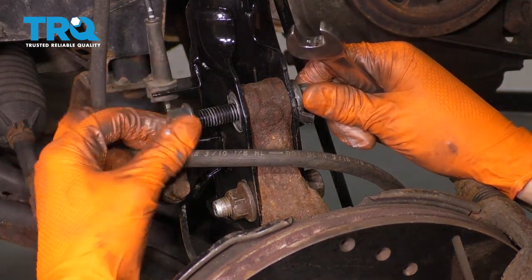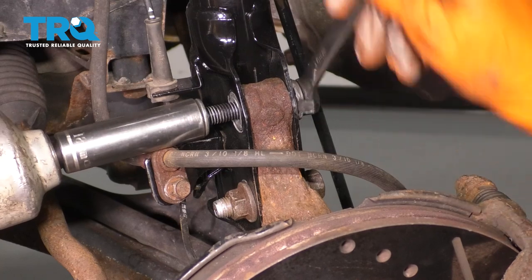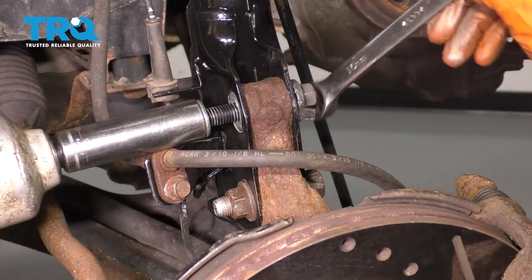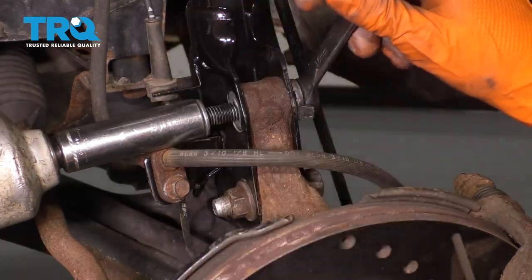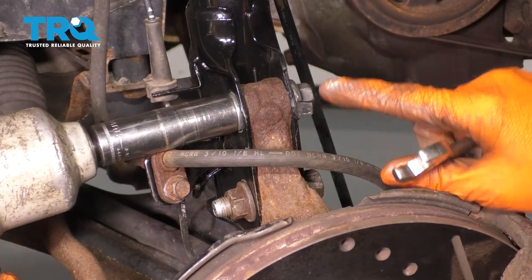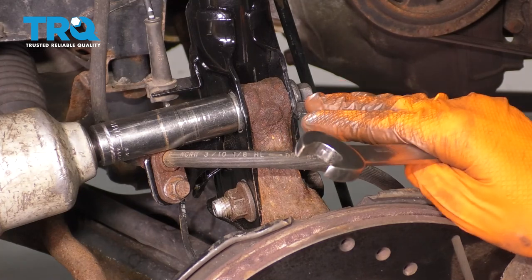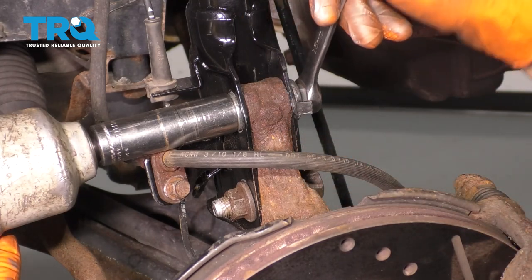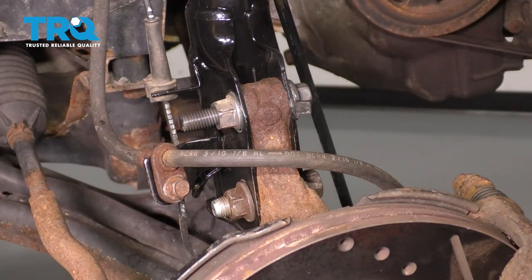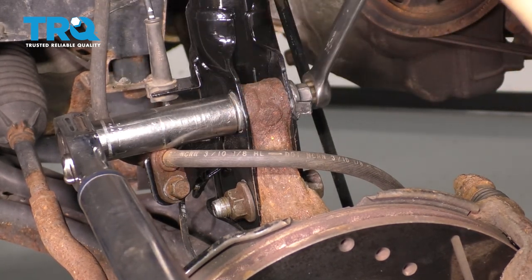Now let's install the mounting nut on the other side and clamp it down — 18-millimeter socket on the nut side while holding the bolt side. I'm going to position it at the most negative point on the camber and start there; the alignment professional can take it from there. This tab indicates the other side of the smaller tab in the strut — you want this facing towards you for negative camber, meaning the knuckle is pushed back all the way. Hold it, snug it up, then torque it to 66 foot-pounds — that's the factory torque spec for these bolts.